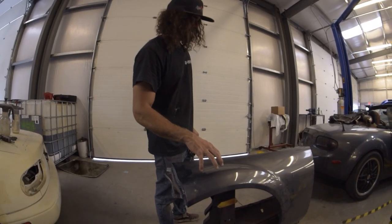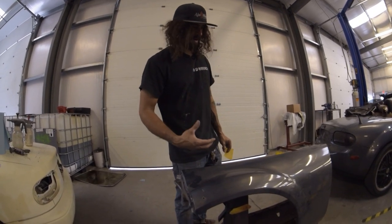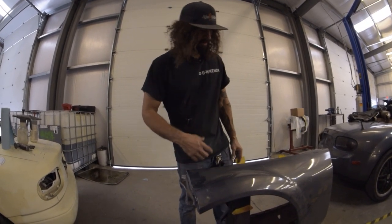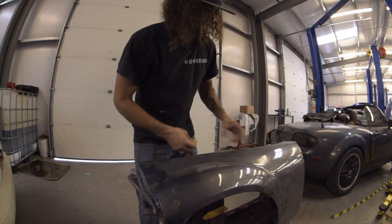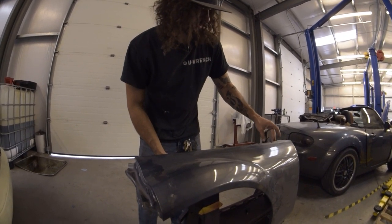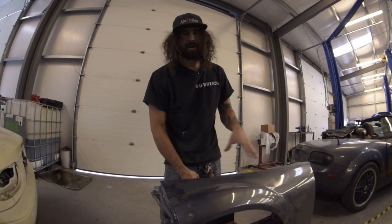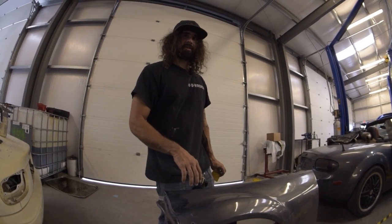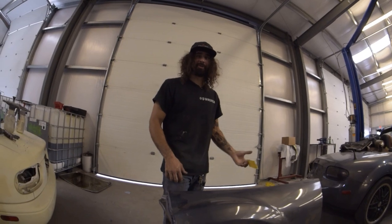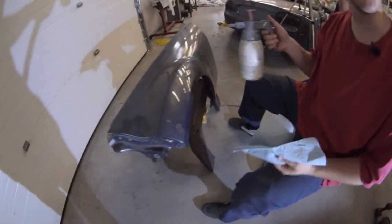On the face, we're just gonna take 320 grit on a DA with a soft interface pad and just buzz down the clear coat. So what we're looking to do is just knock all the texture out. And we're gonna make sure that there's no spots where there's anything shiny sticking through, essentially. Really wanna knock the shine for the next coat to adhere properly. Since we don't care about this car, and it's the only grit we have laying around, we're gonna prep it in 320.